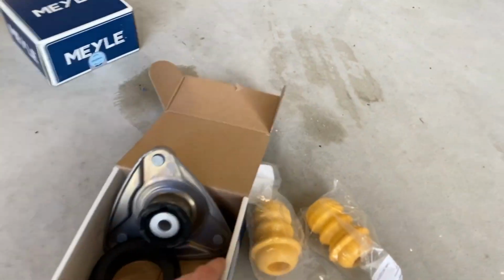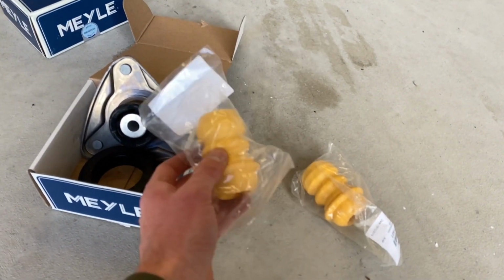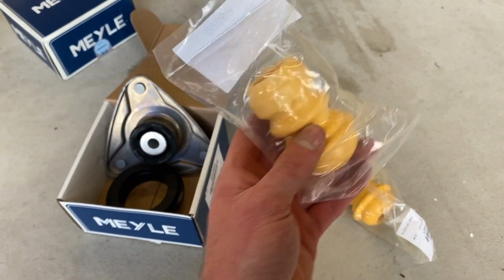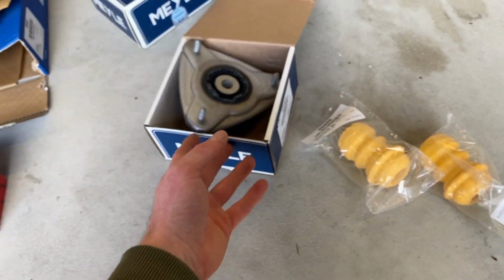So we've got front suspension, top mounts, bushes and bearings. Like with the car in episode 2, the Midnight Blue car, the bump stops are split. And if you've got to take the whole front suspension apart to replace these, it makes economic sense to replace the top mounts while you're there. So we're doing that in standard prep.